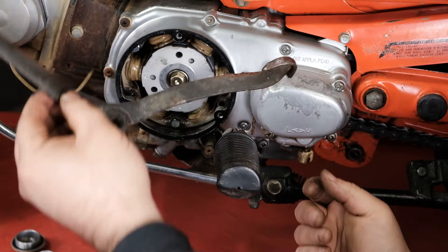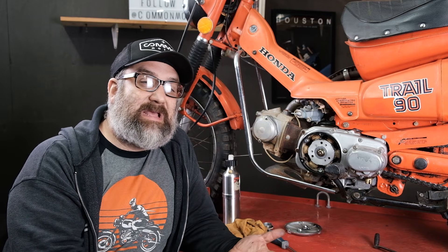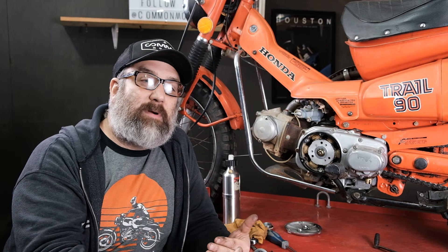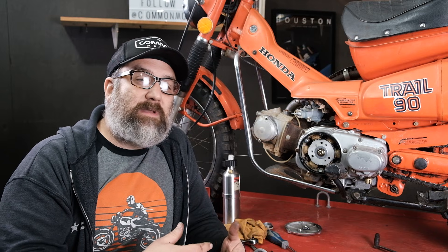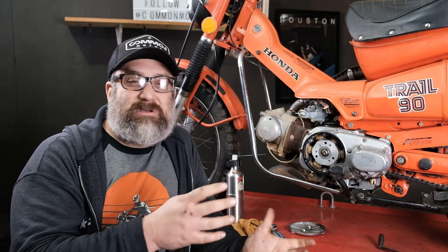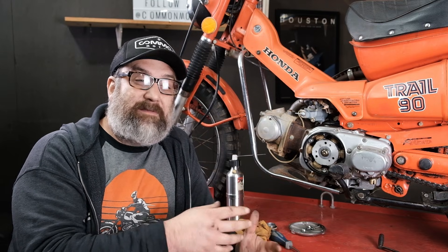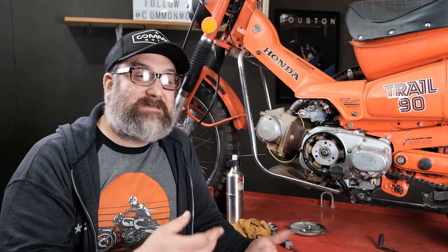When it comes to the adjustment of these tune-up parts — the cam chain adjustment, valve adjustment, and ignition timing adjustment — we have what's called a domino effect, where one part affects another in adjustment. So we want to do them in the sequence that reduces the amount of play or slop in the system. In this case we're looking at the cam chain. You're supposed to do the cam chain adjustment when the bike is running, but since we want to do all these static adjustments on the bike, we're going to have to do a mechanical cam chain adjustment to take out some of the slop.